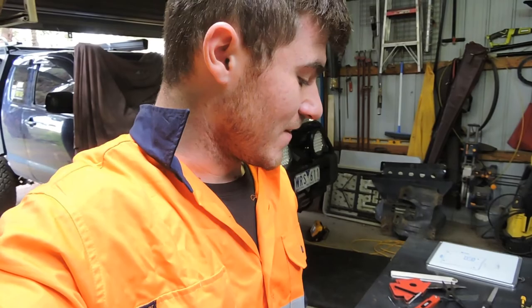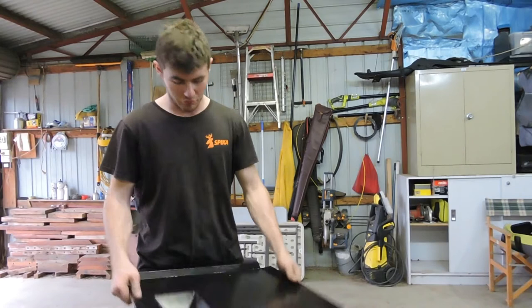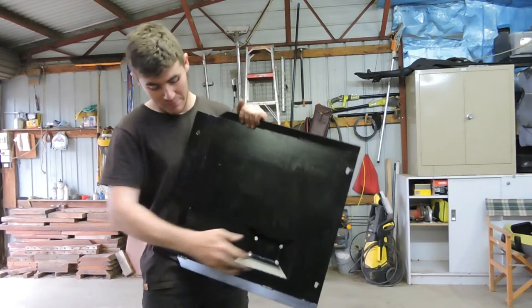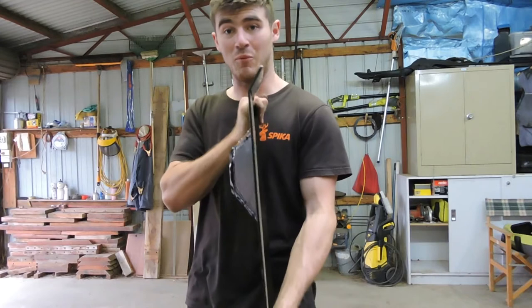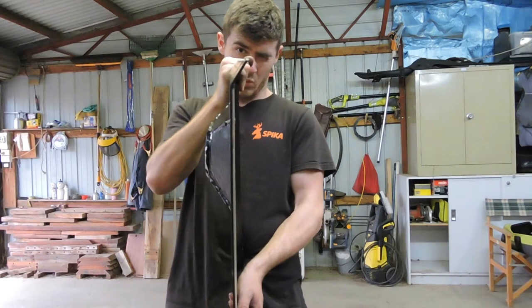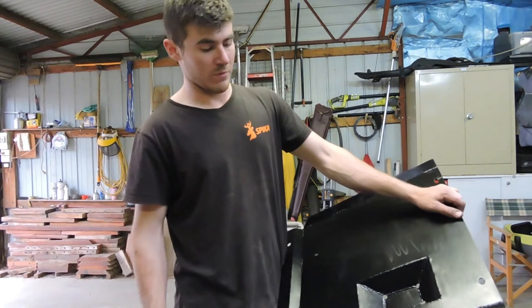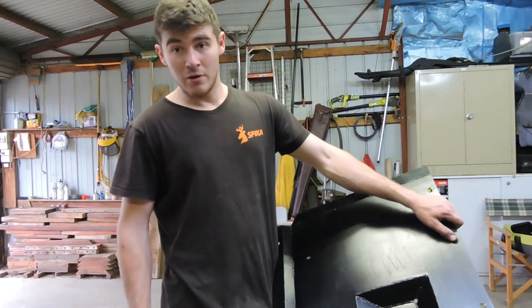It's all painted up and welded up and finished — looks pretty good. I ended up welding this edge the whole way along where the seam is, then just put some tack welds in to keep it nice and strong. This edge here I ended up warping — no idea how it happened when I was welding. The other side is nice and straight, this side decided to warp. It is touching because it's bowing up, touching the diff on this front edge just a little bit. I'm hoping when I bolt it all together it might sort itself out, but we'll see.